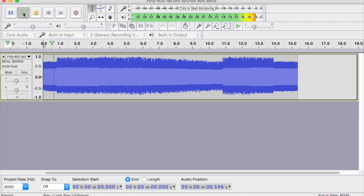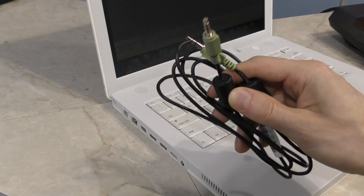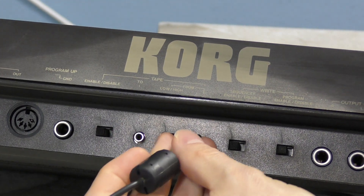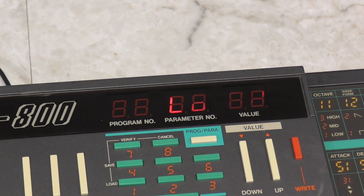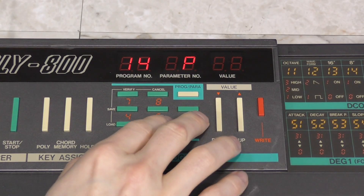This keyboard has a tape interface designed to connect to something like a cassette player where you can save and load digital information, just like an old computer from the 1980s. I found a sound file online of the original default program settings. I loaded it into an audio player on my laptop, connected a standard male-to-male 1/8-inch cable from the headphone jack to the tape input on the keyboard, switched the tape control to enable, pressed the load button, then pressed play on the laptop. The little LED screen flickered while loading, then changed to 'Good.' It turned out that the majority of the sounds on the keyboard when I first got it were not the factory defaults — however, all the ones I cherry-picked and played earlier in the episode are the same, except for sound number 32.